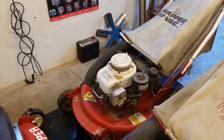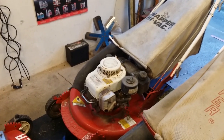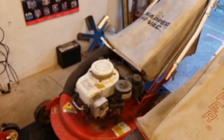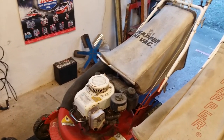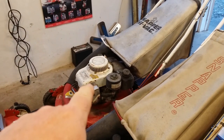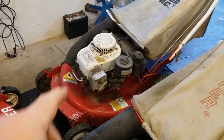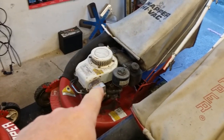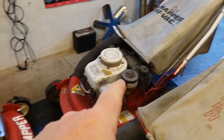It started on the third pull about a week ago when I cut the grass at the house. Unfortunately the rope was pretty rotten when I tried to start it today and it broke, so I had to come out and get the rider to go home and cut the grass. I haven't serviced this mower yet this season — it's still running last year's oil. I need to sharpen the blade a little bit. It just needs a service, a rope replacement, and it'll be good to go.